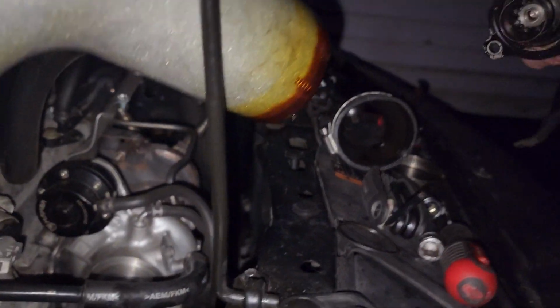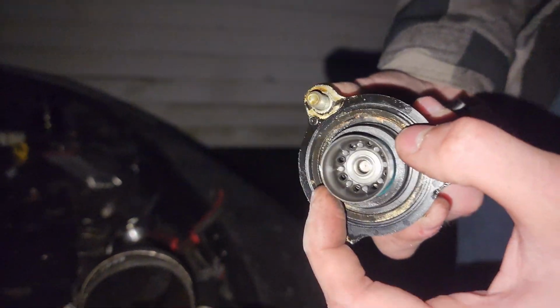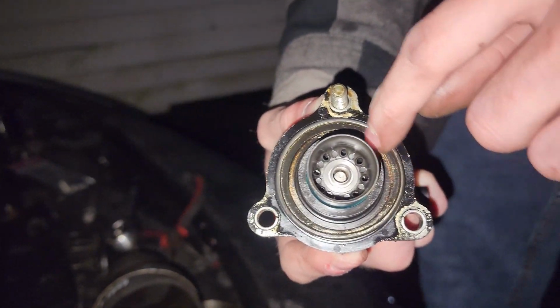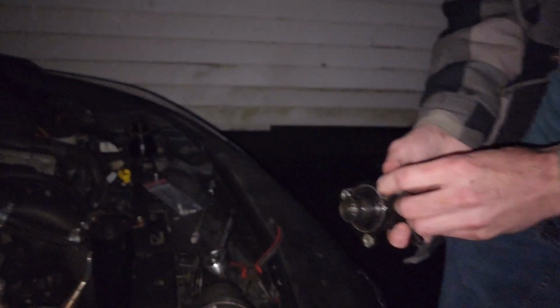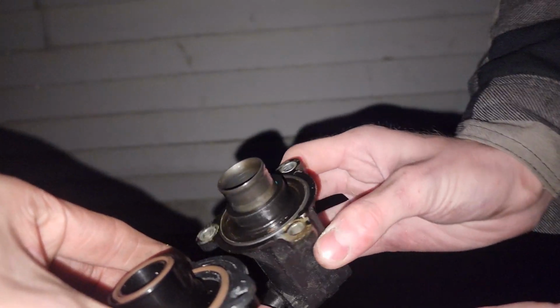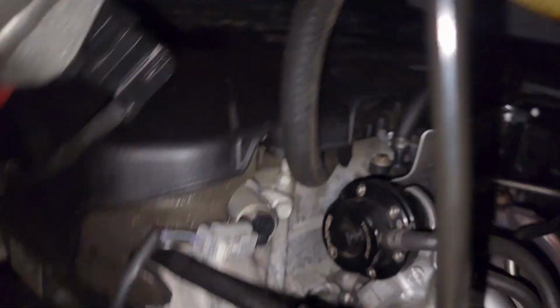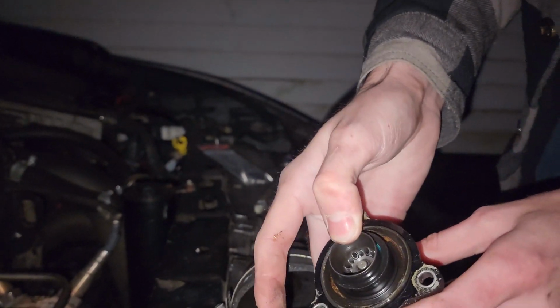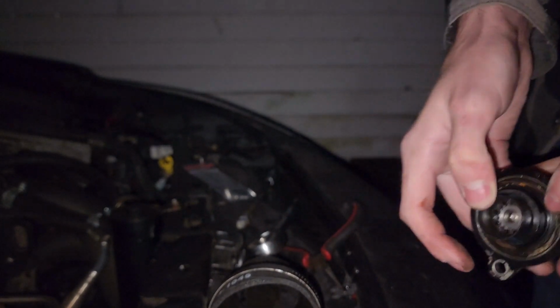Yeah. So when you're doing a BNR one, this whole thing comes off. And then this right inner lip there, that's actually separated. This whole thing comes out. And then you're left with just the solenoid, which connects to your go fast bits or BNR bypass valve. Wow, about the same size too. But this one does that. That's why. So also, if you look, this is the only thing that's holding it back from venting boost. So that's why these are so terrible.